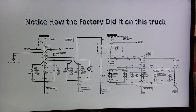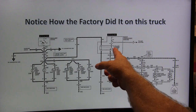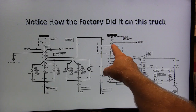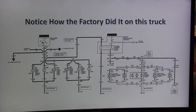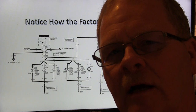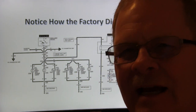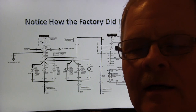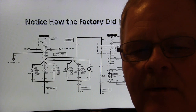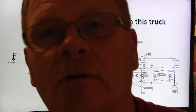The factory on this truck had a relay right there under the trailer adapter for marker lamps. Some of them only put a relay for the marker lamps but let the turn signals be carried by the existing wiring. Personally I don't like that. Most of the time if you put a full trailer tow package on, it's going to have a relay for everything.